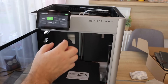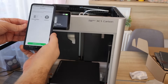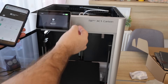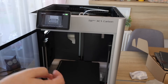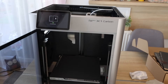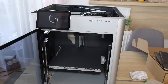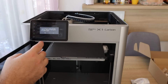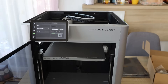Choosing the language, connecting to the network, scanning the QR code — interestingly it didn't work with the 5GHz network, only with 2.4GHz. Accepting terms and conditions and some privacy policy — I'm really curious how many users will actually read this. I removed the white foam and it started with the calibration. Calibration complete. A new firmware update — including downloading, the whole process was finished in approximately 10 minutes.